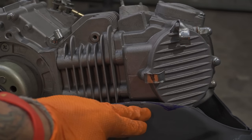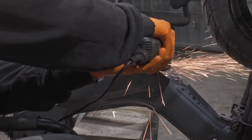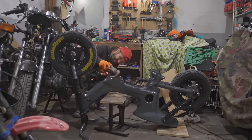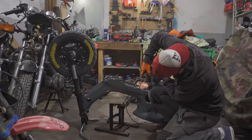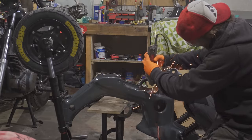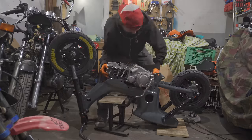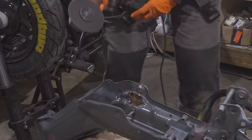We don't want the bike to fold over like a banana. I also read about other ways to fit the engine in — it would be to push the sides of the frame outwards. But I thought cutting is a better choice because pushing the frame outwards would certainly change the geometry of the bike, and might result in fatiguing the metal and making it more prone to folding over. All in all, this was about 4 hours of cutting and measuring and trying to squeeze the engine in.